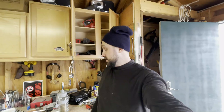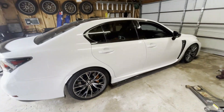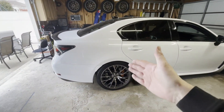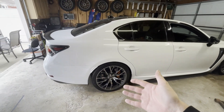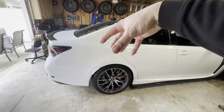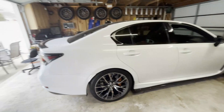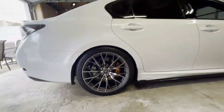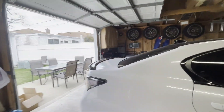Job is done. The front was super easy, quick and easy. The rear was a pain in the ass only because I didn't want to drop the lower control arm, so I just removed the lower bolt from the coilover, removed the three nuts on top, and had to wiggle it out — which was just annoying. This is how she's currently sitting.